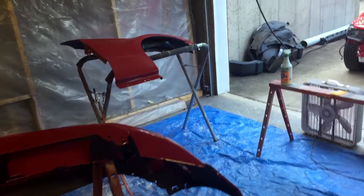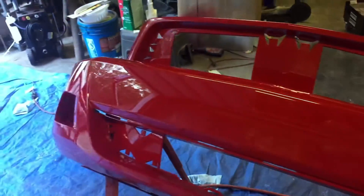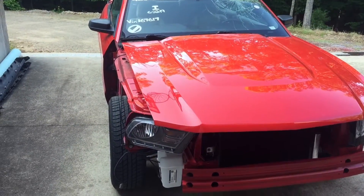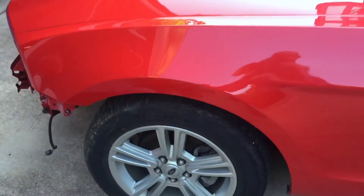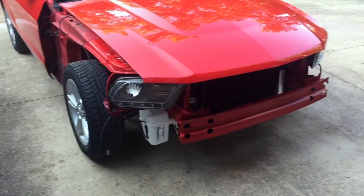I've got the front fender all sanded down to 3000 — it's ready to buff. I've got to sand a little bit on the bumper, although it's really smooth, so I'm just going to sand some of the flat areas. I have to have everything done and this thing back together by noon and it's about seven o'clock now. I've got a guy coming to pick up the Mustang to replace the windshield — he's going to drive it — so I want the inner fender liners back in so rocks don't come up and dent the inside of this fender I just fixed. Got a lot to get together in a short time, so let's get some sanding and buffing done and then start reinstallation.